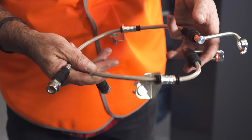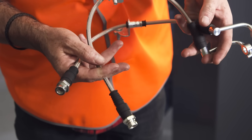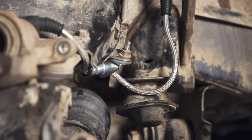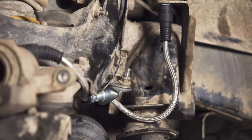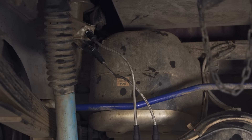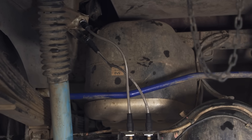Here's why all four-wheel drivers need braided brake lines. Firstly, they're more bush-proof and won't be as prone to damage by a tree root or rock. Secondly, they don't flex and expand like rubber ones, meaning 100% of the brake fluid goes straight to the caliper, giving you better force, more control, and smoother braking.